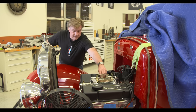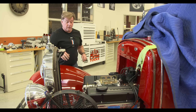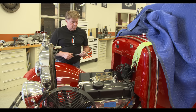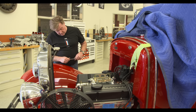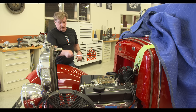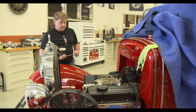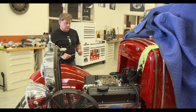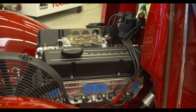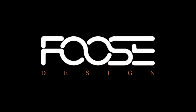We actually got this motor in without having to pull the radiator shell and the radiator out. We've got it bolted up to the transmission. We'll get the flywheel and torque converter all bolted up together, put the pan back on, and start assembling the rest of the motor. Then I've got to get the exhaust back on, and pretty soon we can fire it.